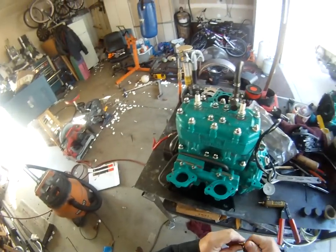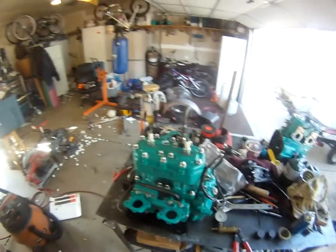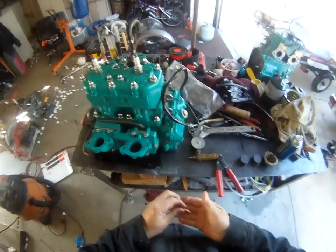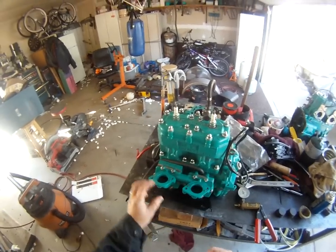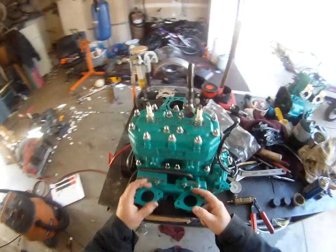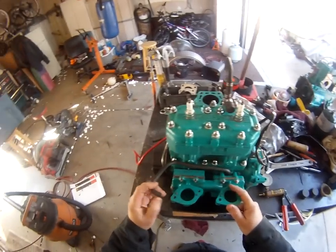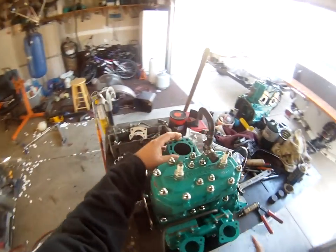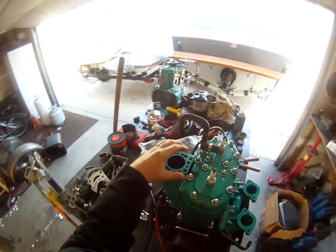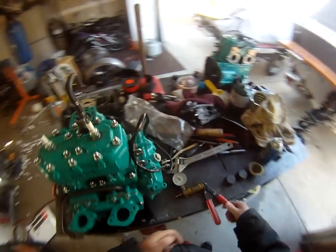Welcome. We've got a Kawasaki 750 big pin engine here and we're going to do a leak down check on it. In order to do a leak down check, you've got to have your carburetors off. You have your pulse line right here, which is for your fuel pump to your carburetors — you're going to be using that. You're also going to have to have the exhaust manifold off.